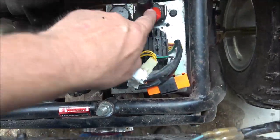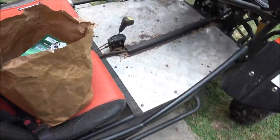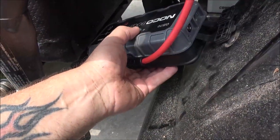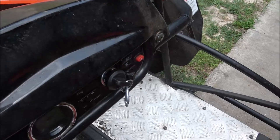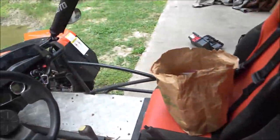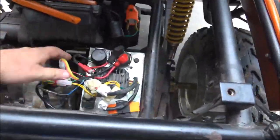Okay guys, I got the CDI box in, got the starter solenoid in — it just plugged right in. The wires are a different color but they are correct. Got the coil on there for him. Now let's give this a shot and see. I gotta put that in and turn the jump box on. There we go — we're in there! Awesome.